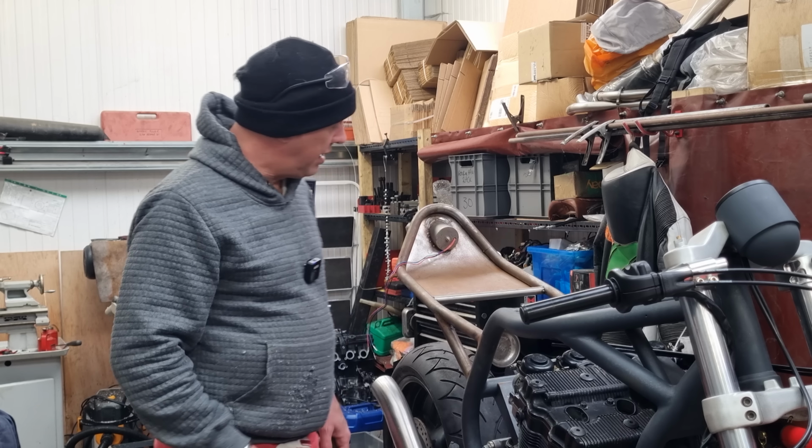So I've spent a couple of hours on it actually. It takes bloody ages grinding, especially when you're trying to get into all the nasty little bits with a ball die grinder. These things are brilliant for getting into all those little nooks and crannies, and you want to have some sort of radius on it. The only trouble is that the way you're going in with this, you can't then go in with that finger sander thing, because the radius on the end of it is too big. But I should be able to get in there with the mini DA and dress it all up once it's all fitted together. For now, I think it's good enough that I can start mocking up a template.